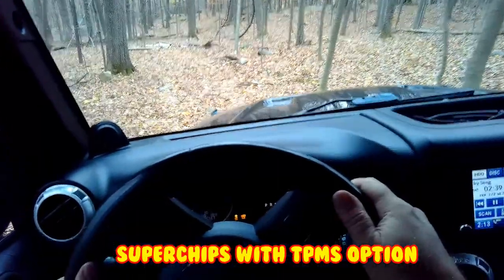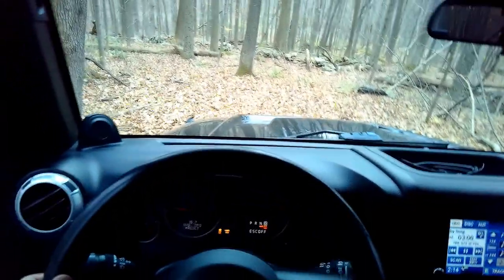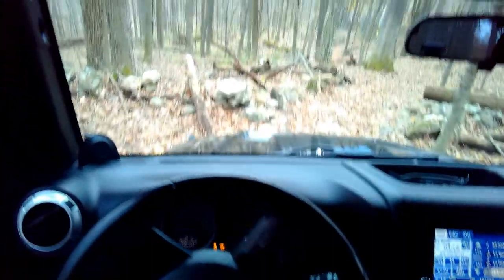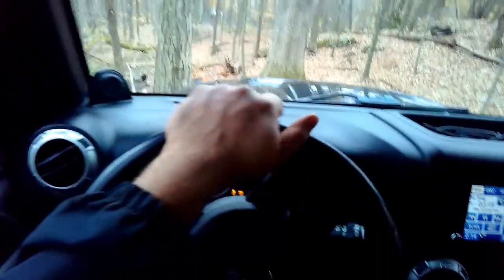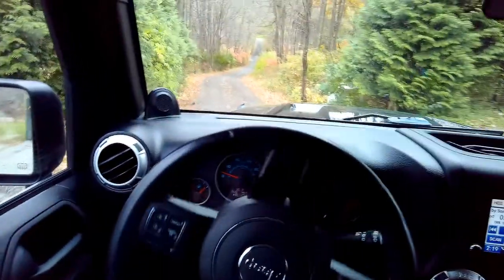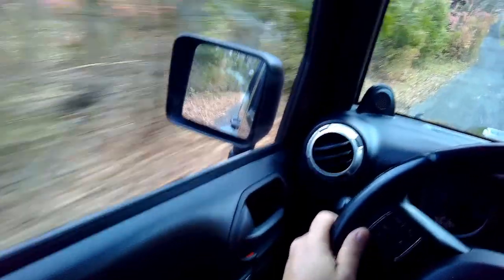I have to get the programmer so I can program out these tire sensors, or get them so I can lower the threshold. You can't put the tires any harder because then it'll be riding hard as a rock and it'll wear bad. I think I'm gonna have to go to 28 pounds and then just program them out or set a lower limit. The sway bar should go back in — kind of evens out the two bars so that spring can push that clutch back over. Gets the mud out of these tires. Yeah, you can see it flinging.